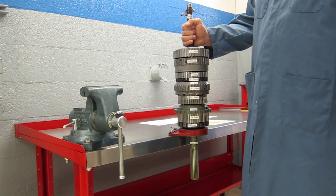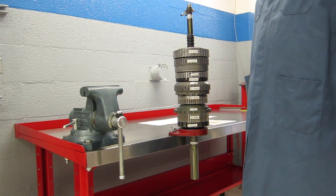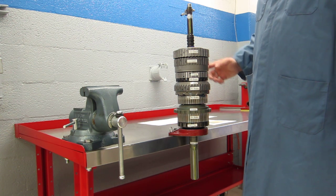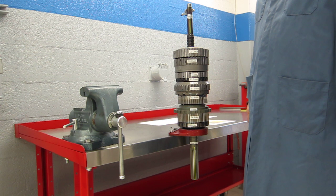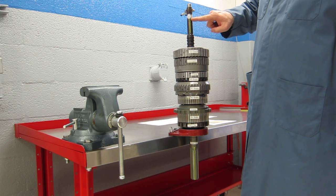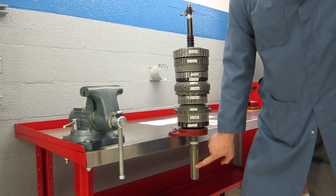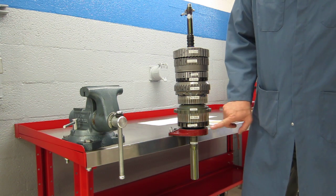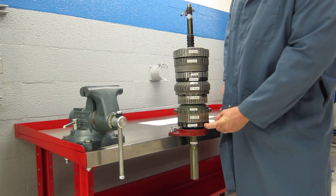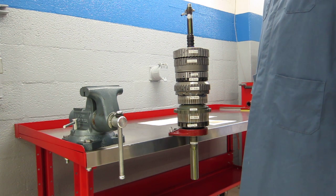What I'm going to do is take you through each of the six forward gear ratios, show you which brakes are held and which clutches are applied to get the different gears forward and then also reverse. We have the input shaft here with a yellow mark as an index, and the output shaft here with a yellow mark as an index. Down at the bottom is our parking gear where the parking pawl is going to engage and keep the output shaft from turning to hold the vehicle when we're in park.